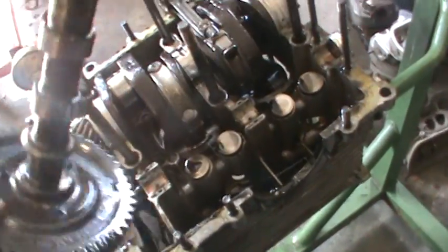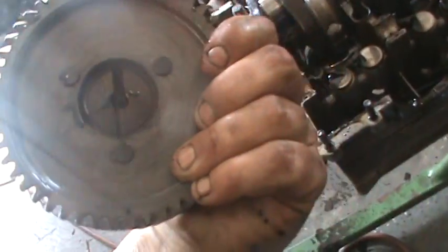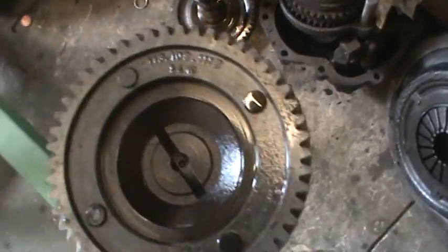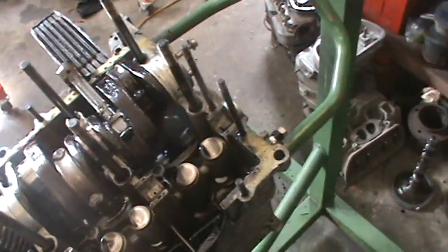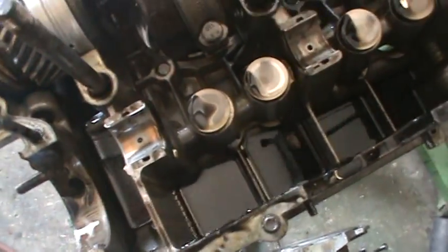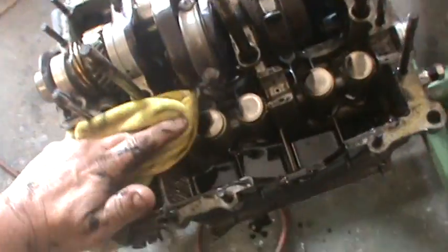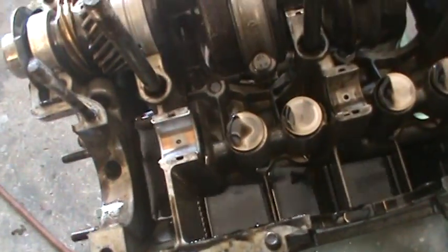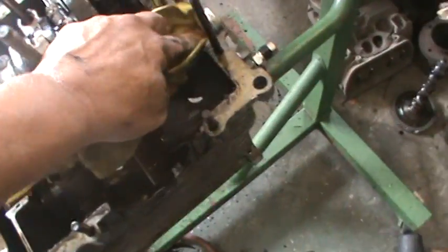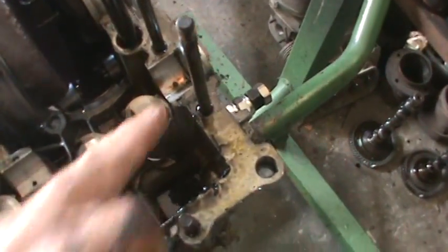First thing we do is pull the cam out. It's an early model flat cam, which is surprising — the dishes are the late model cams. This one has three rivets and a flat gear; that's an early model cam. All aftermarket camshafts will also employ a flat cam. Now I've never seen a cam bearing completely wiped out like that — all the way to the copper. That's from not properly fitting the cam; it obviously didn't turn very well when they bolted the case together. You can see the back is also copper on the cam bearing.